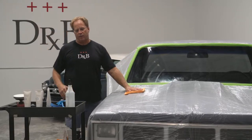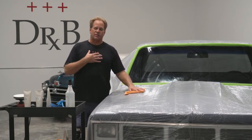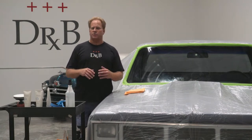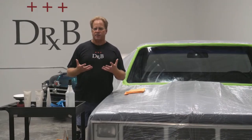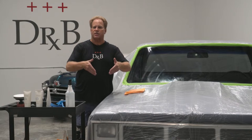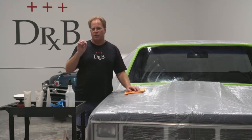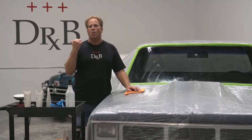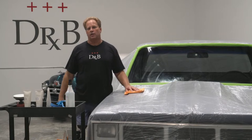And I always tell people, I'm comfortable doing that. I've done it a whole bunch over the last 10 years. But I always tell people that you wanna be careful when you take a project like that on, because sanding glass is easy. That's putting scratches in, okay? Anybody can do that. I could do that blindfolded. The tricky part is getting them 100% out. That's where it takes some talent, some skill, and a little bit of experience.